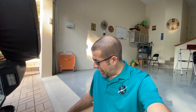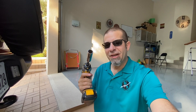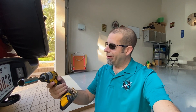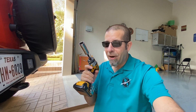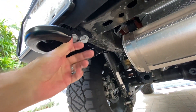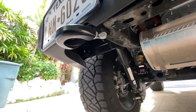This should be pretty easy to do, assuming those bolts come out fairly easily. All you need is a ratchet — I've got the big one here — and a 13/16 socket. I'm going to try to use an impact to loosen it up; it makes it much easier. This is a DeWalt 20-volt Max — a few people have asked what impact driver I use. DeWalt, always had good luck with it. The bolts are right here, one here and one here, so we should be able to just pull those off and remove this little tow hook.